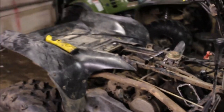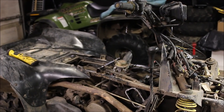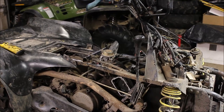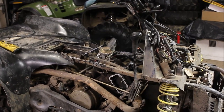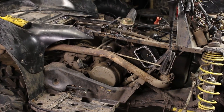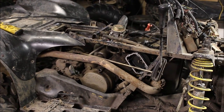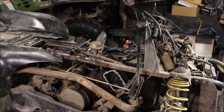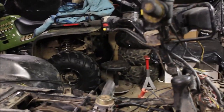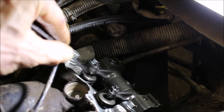Hopefully that'll correct my issues. It was blowing a little black smoke, which right away was telling me the valves weren't opening at the correct time, or possibly valve seals are leaking. Here's my quick tip of the day: if you've got a Scrambler or even a Sportsman 500 that's spitting, sputtering, or backfiring when you give it full throttle, check your timing and check your chains. I can't stress enough — replace that chain. This one has over 4,000 miles on it. I've got a new chain ordered, and I'm going to reset the valves and timing.